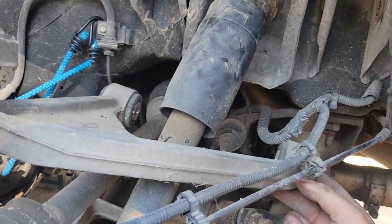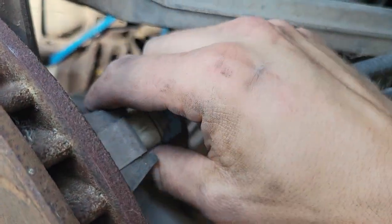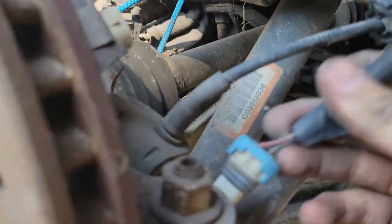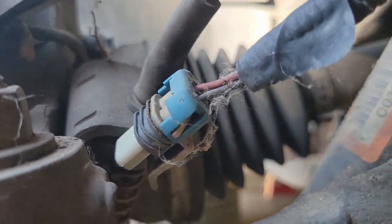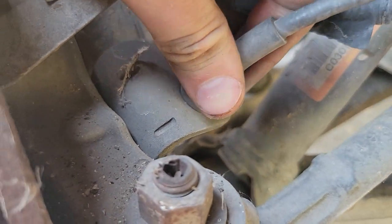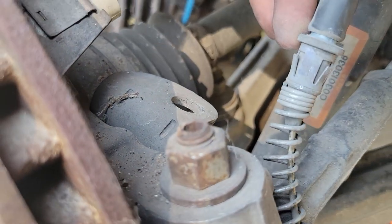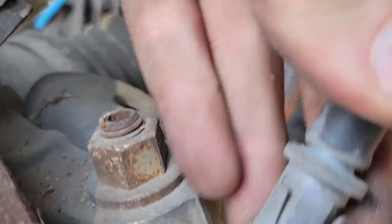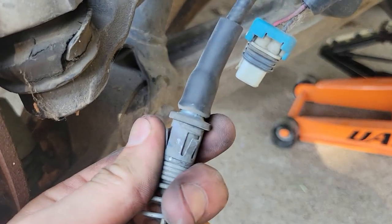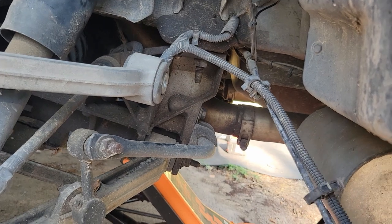Be careful of your wires and your e-brake here. I'm going to take this plug off — that's unplugged now. We just have to unclip the e-brake. To free the e-brake cable, you push in these little tabs using small pliers, then pull it out. Now it's completely free and out of the way.